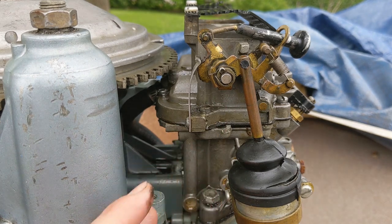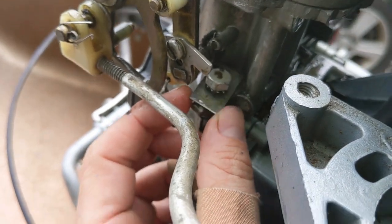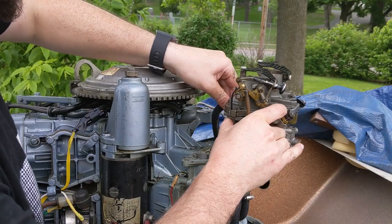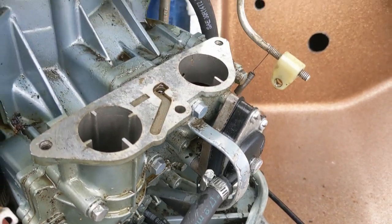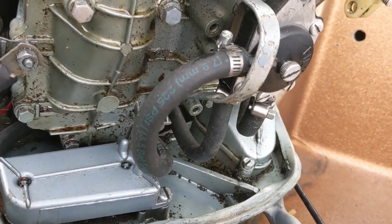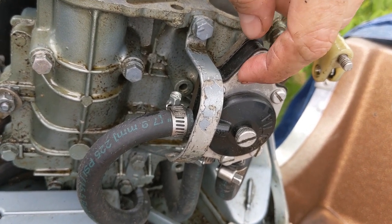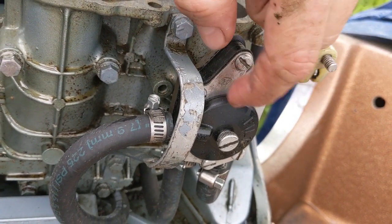I'm going to go ahead and take this carb off, curse at it a little bit, and see if I can find a rebuild kit on the internet. I don't even know what's going on on this side — somebody's added a little metal plate, maybe as a stop. I better take it all off and see. These fuel lines seem to be in decent shape, which is nice. It looks like somebody's done some work on this. Sometimes when you get one of these free outboards from 1968, they were last serviced in 1968. I might have to dig into the fuel pump too — if it's original and somebody's used modern gas with ethanol, it might be all rotten. In the 60s there was no ethanol and everything was full of lead, so modern clean gas destroys these. But we'll look at the carb first.